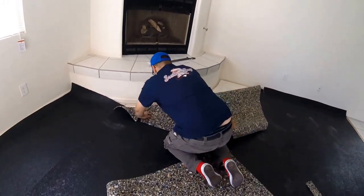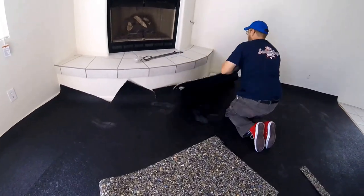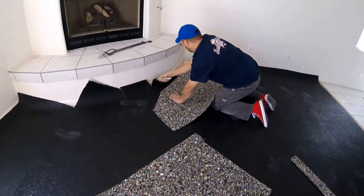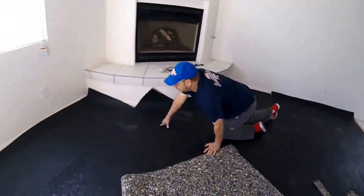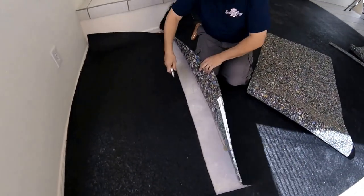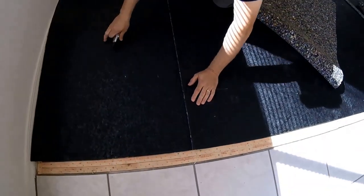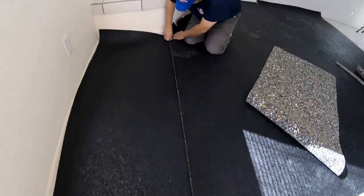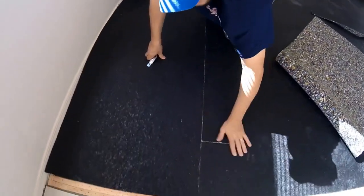Since this area is rounded, I'm just going to get in a couple of relief cuts right there to make it wrap around easy. Get the big excess out of the way, and it's easier to trim in like that. I'll keep my knife angle down. Where I overlapped the pad here, I'll just cut right up next to this factory edge — that way I don't have to worry about it matching up because it's going to be straight since I just cut it against my other pad.